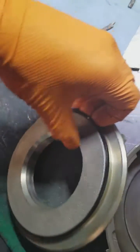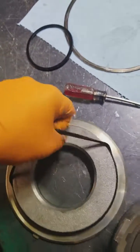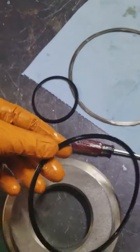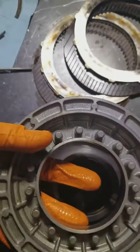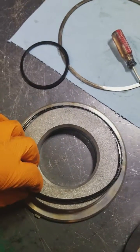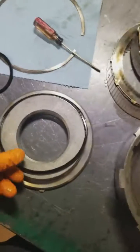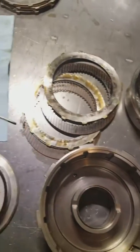You can see where the lip is facing upwards — it should have been facing down. What happens is when fluid is applied to that piston, it should pretty much inflate that seal. You can see there's a little lip right here on the outside, so the piston should be applied in the drum this way when it comes up. When they installed it backwards like this, there's fluid that was slipping past the seal itself, and it caused the clutches to not receive the amount of fluid — or pressure — that they should, and it causes the slippage that you see here.